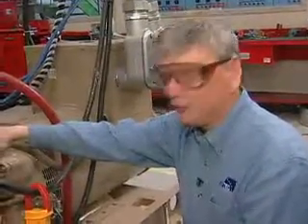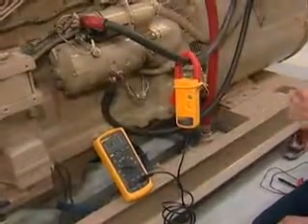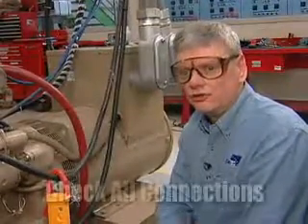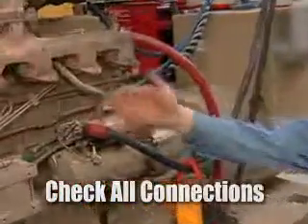If we had some problems they're going to be in one of two areas. Either the starter motor is going to require significantly less than 240 amperes, or significantly more than 240 amperes. If it is less than 240 amps, we're going to check all of our connections — both to the starter through the positive and from the starter on the negative back to the battery bank — by doing a voltage drop test.